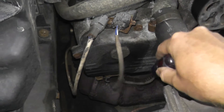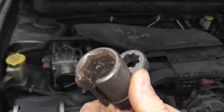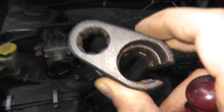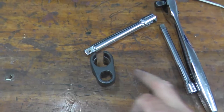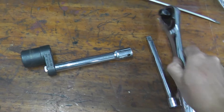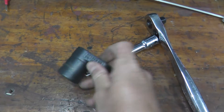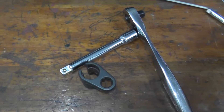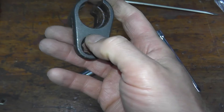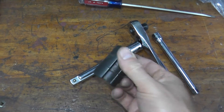The rear sensor will be shown in a couple days. To remove this, there's a socket known as an oxygen sensor removal socket. There are different sizes in terms of the drive — this is a half-inch drive socket, with a half-inch extension and half-inch ratchet. They also make these for 3/8 drive. When you purchase this socket, make sure you purchase the right drive for the tools you have. This is around $9 and I'll include a link in the description box. Sometimes you can even rent these from the auto parts store.